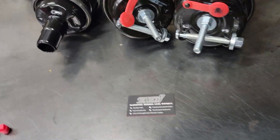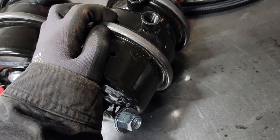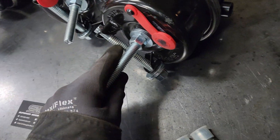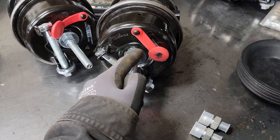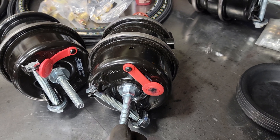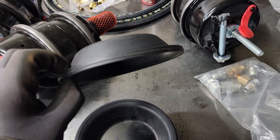As you may have noticed, they have crimped these off instead of putting clamps on them. Apparently soldiers in the army were getting injured by taking these off without putting a T-bolt in and tightening it down so there was no pressure in them. There's a tremendous amount of pressure in those if you do not cage them. I will leave links in the description - surprisingly these were less than five bucks a piece, it's a real simple upgrade.